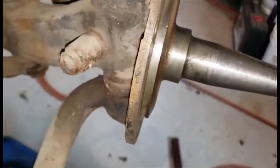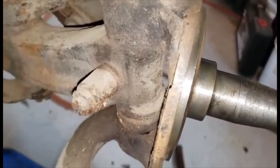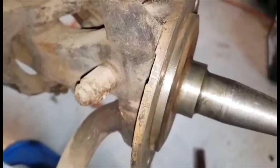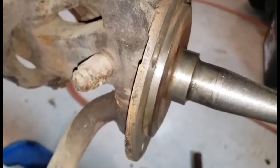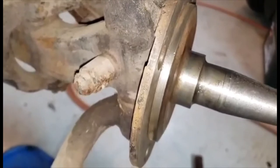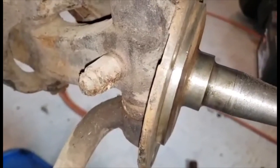The other one came off pretty easy. Take it off and then put a regular nut on it. It's a cotter pin that goes all the way through that holds the kingpin in, and you need to put a regular nut on it. The 7/16-20 is the nut size.